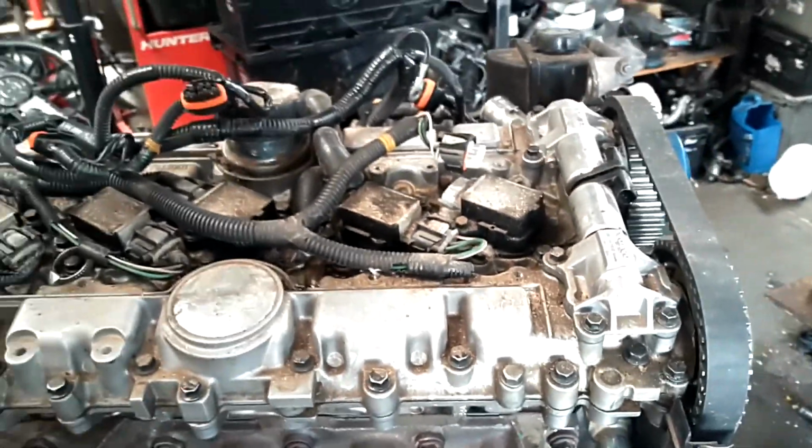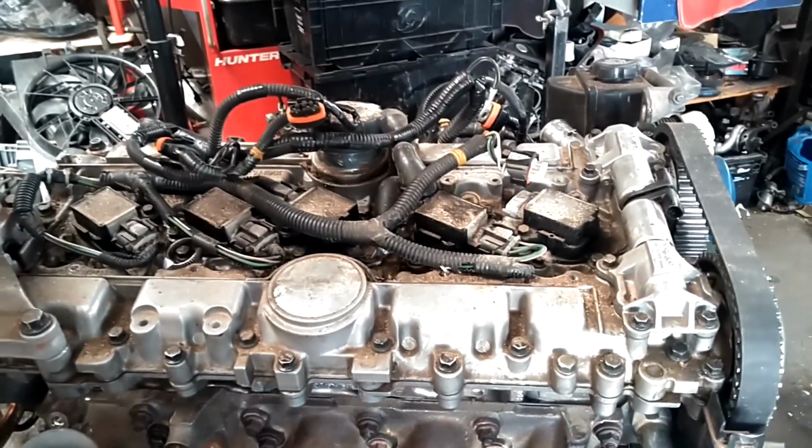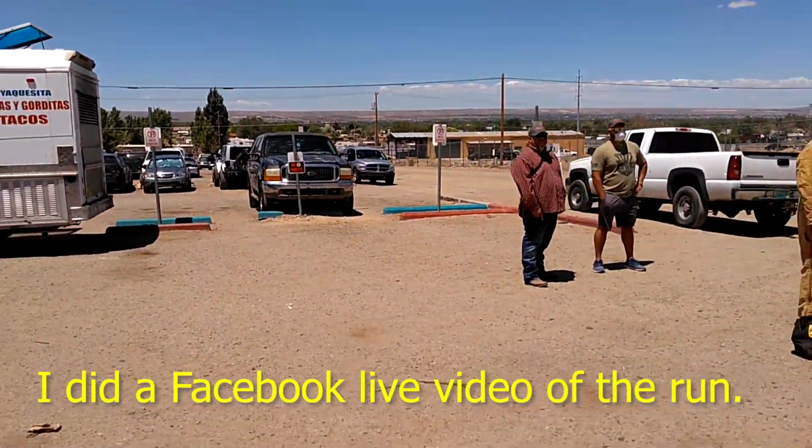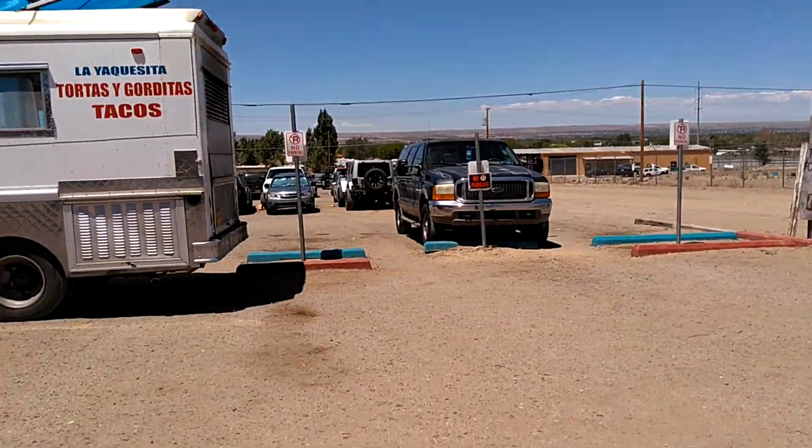So I'm running down to the junkyard to see if I can find some coils real quick. Wasting time. Should have opened my ECU package long ago. The ECU that is set up is already pre-wired from VAS. I have the wrong coils. I've got gray tip coils and I need black tip coils. So I'm headed out to the junkyard to try to find 5 good coils to swap them out so I can continue my install. The line is building down at the junkyard, getting longer and longer.